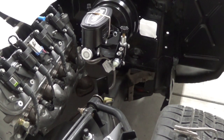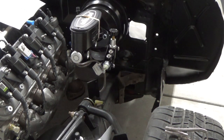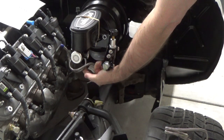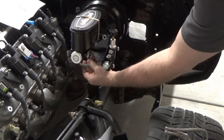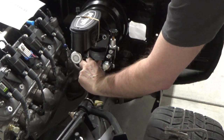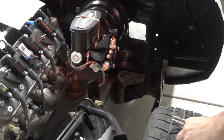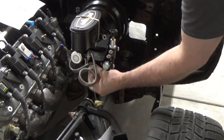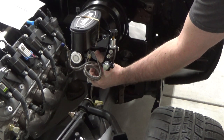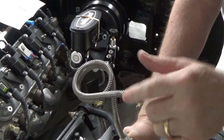So we are discussing the brake lines here. These are the factory lines, which aren't really designed to work with this proportioning valve. This line comes from the passenger side and ultimately has to end up over here. I think we can just kind of twist it around and get it in the right place. This one goes in here like so, but it's pointing off in the wrong direction, and this line needs to be twisted that way.